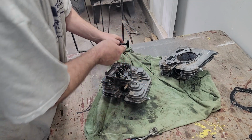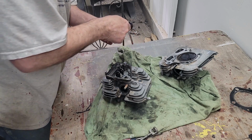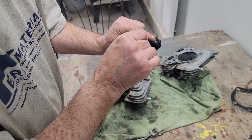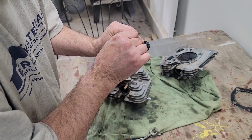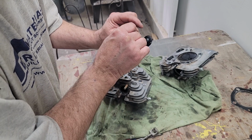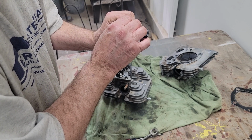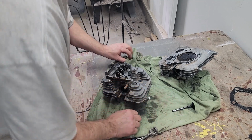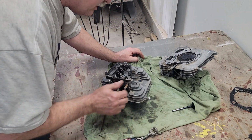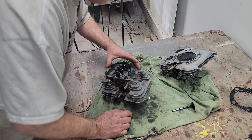Look at the sealing area without wiping too much off. Sealing against the guide. Looks like a little bit of pitting, maybe. And it's not hitting at the top, it's not hitting the bottom, it's hitting in the middle, which is good. Needs to be brush wheeled. The guide is right here. The seal is right here in the guide, and it's not ripped, if that means anything.